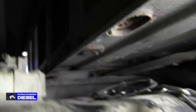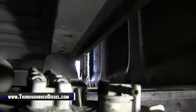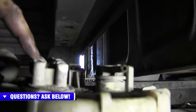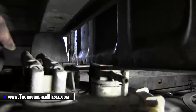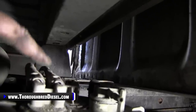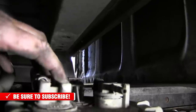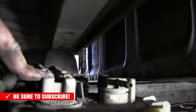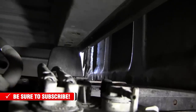With the tank lowered, we can get to the sending unit a little bit better. Don't drop it too far or you'll break the sending unit out. These fuel lines have quick connects on them. Get a pair of needle nose pliers, pinch the plastic quick connects together, and then pull your line straight off. This is the pressure side and this is the return. The return clip here you're going to be reusing on the new sending unit, so make sure you don't tear it up. Start with the supply — pop it off — and that gets you more access for the return side.